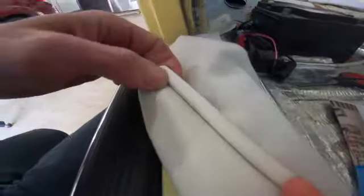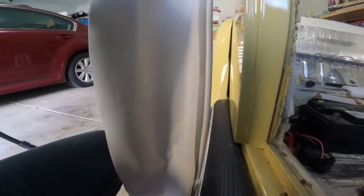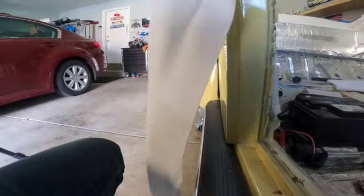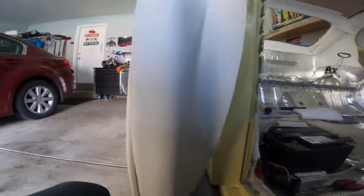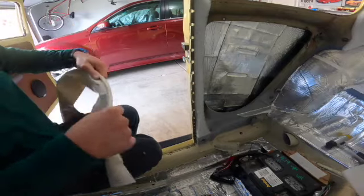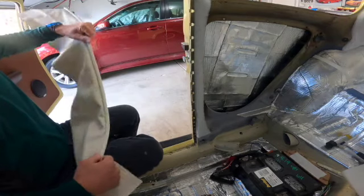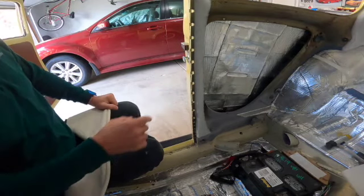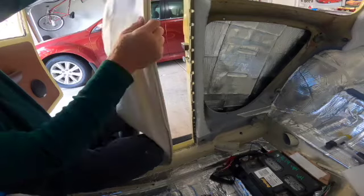We'll press the wind lace back into the clippers and ensure that the back side of the liner is facing towards the outside, so that when you install it and wrap the B-pillar, your finished liner surface is facing inside the car. Before you press the wind lace into the B-pillar clippers, ensure they are open wide enough so the clipper tips are properly aligned with the back crevice on the wind lace.